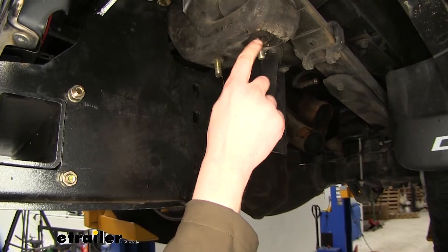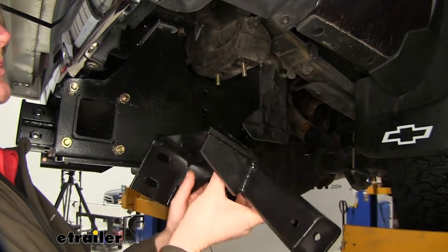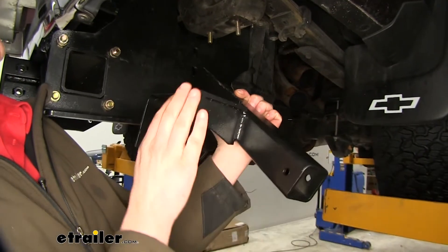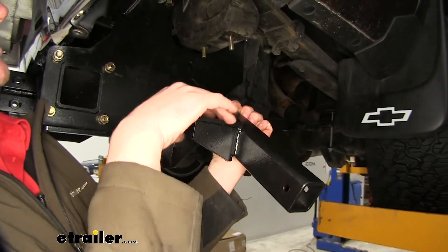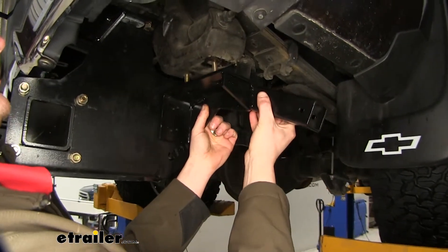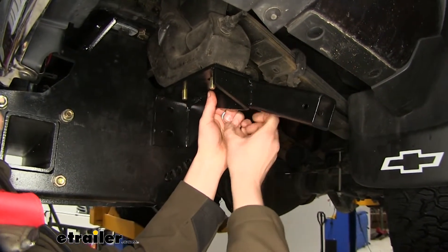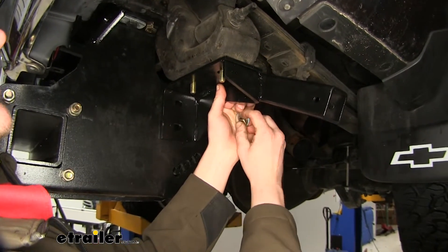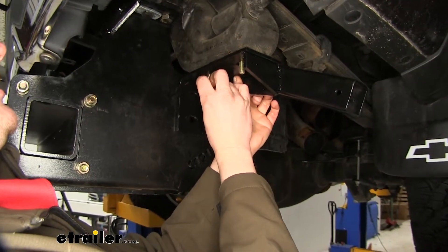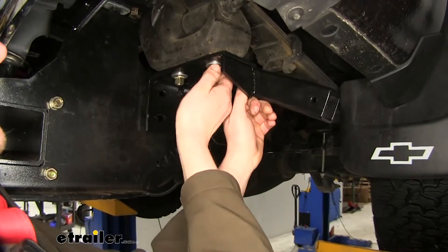You'll repeat this same process for the other hole on this side, and then both holes on the other side. We'll now get our camper tie-down in position. The tie-down should be placed with the tube on the side of the bracket towards the front of the vehicle, and the L bracket half towards the back. We're going to slide that up, making sure not to push our bolts back up into the perch. We're then going to use a flat washer, lock washer, and nut — these are the smaller ones that come in the kit. We don't want to fully tighten it, just hold it up there, and do the same thing on the other bolt sticking down.